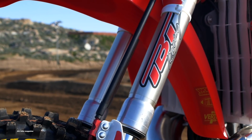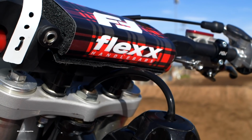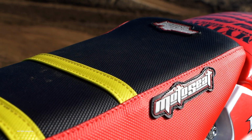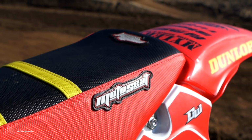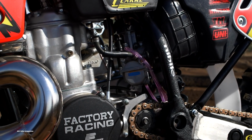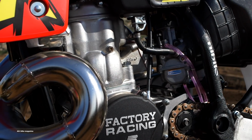Like we mentioned before, all of the internal parts were replaced with a combination of aftermarket parts from a Wrench Rabbit rebuild kit to some stock OEM Honda parts that you can only get from Honda. One of the cases was replaced. One of the cases is still available from Honda. One of the cases isn't available. Luckily, we needed the one that we could still get. Found it at a dealership that still had one in stock, so we got lucky there.